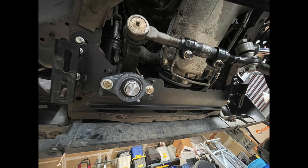It really protects your unibody, which is another good place to check for any play. You'll hear some popping there. It's known for cracking there. Or the steering box spacer, that's another good place to check for any play in your steering, just to make sure the steering box isn't moving. But it protects all those things, helps them, and it really tightens up your steering. I love it. The Ironman 4x4 Fab steering brace is probably my favorite upgrade in steering.